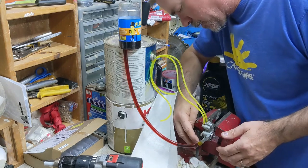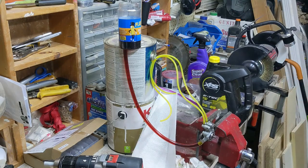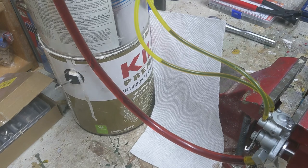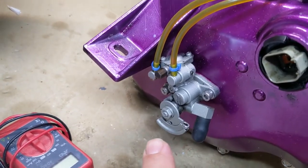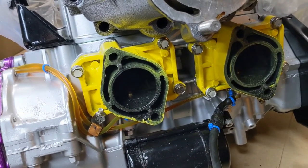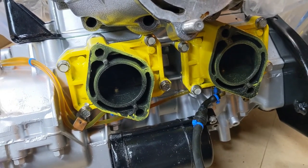There are marks here that you have to line up, then push it over. The pump is working. This is what it looks like with the pump on the engine — still got oil in the lines, and those are connected to their injectors inside. Just to be sure, I went ahead and did a second test: I ran that pump until I saw oil coming out of those injectors and measured how much oil was coming out.